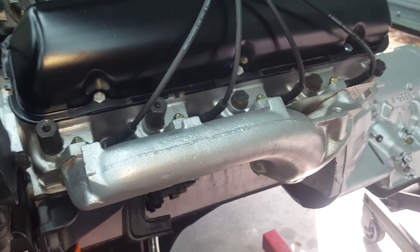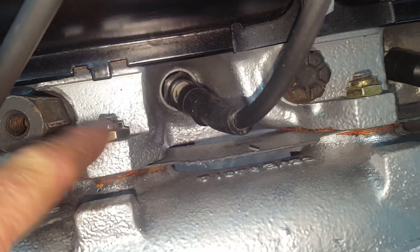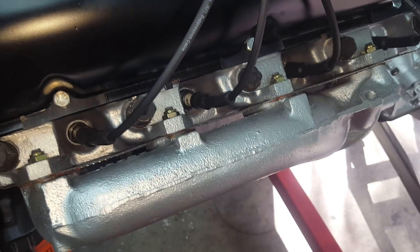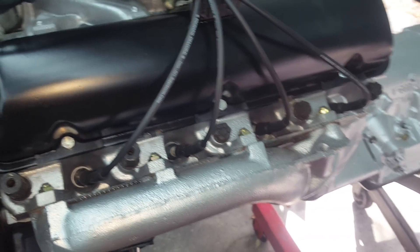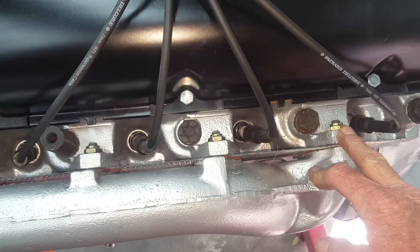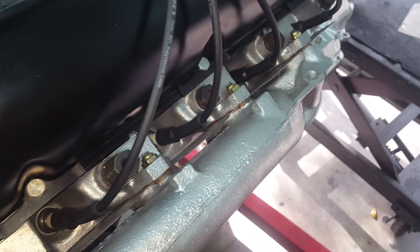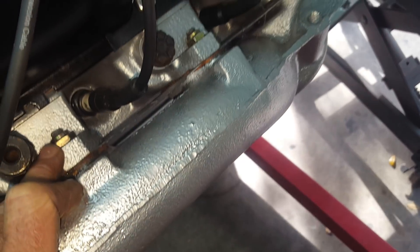These nuts are lock nuts — you can get these to replace the original brass nuts, which are a real pain to take off. The manifold gaskets are notorious for leaking, so it's not an easy job, especially without a lift or the right tools. It's actually easier to pull the motor out to do them. The original brass nuts — you may have to torch them off because after 50 years they tend to spin. Heat them with a torch carefully and the brass will melt off the steel stud.